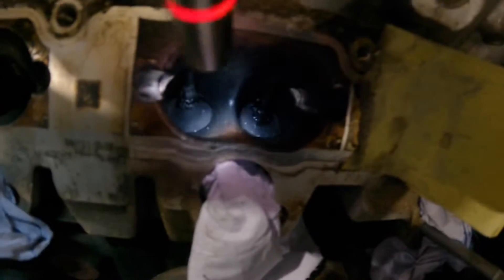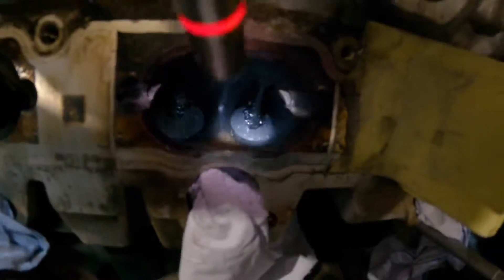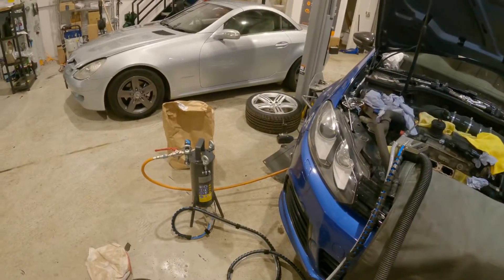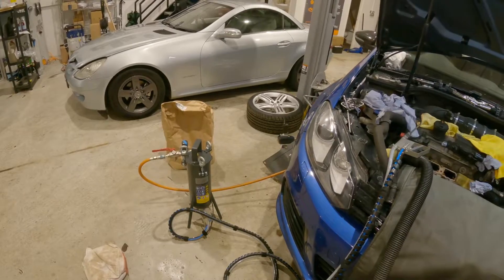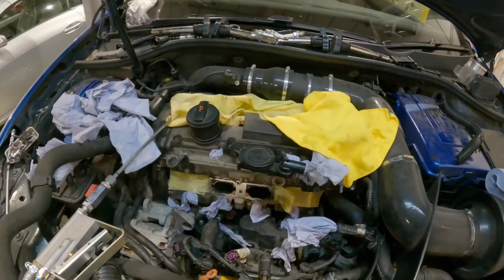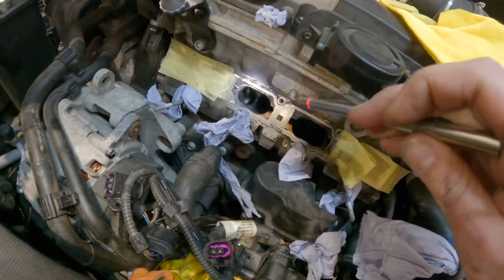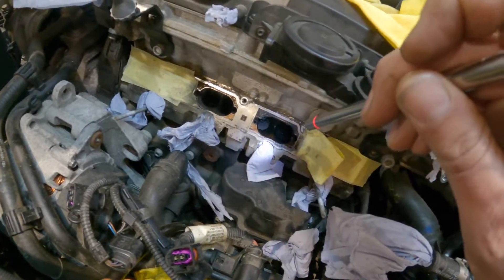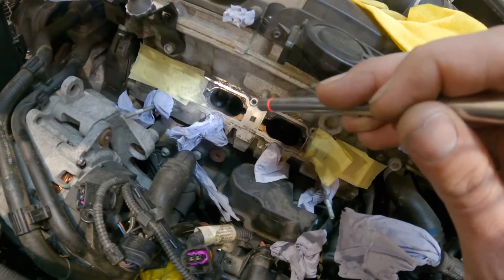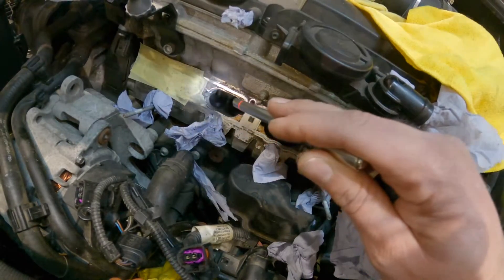And then there is cylinder 3 yet to do. Like I say, all that does is just use walnut shells - we pass them in there, obviously making sure that the valves are closed. We found that's the best method of cleaning these. In a direct injection engine, pre-direct injection engines would normally wash the back of the valves, whereas the injectors now just go straight underneath into the combustion chamber.